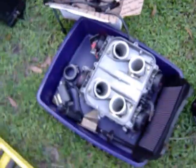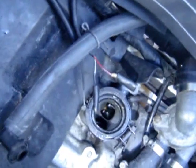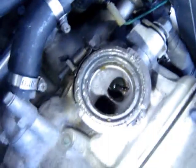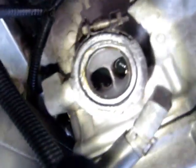I'm doing two carbs right now along with the coil packs. If you have a fuel-injected engine, you're going to have to do a throttle body — that's where the butterfly valve for the air intake is, where air is distributed to the injectors. On a carbureted engine you don't have a throttle body; you only have those valves, and in that case you'd have to lap the valves to get them to seat properly because of the carbon. But this Berryman is working — it's been 15 minutes and the liquid has turned black. It's stripping that stuff off.